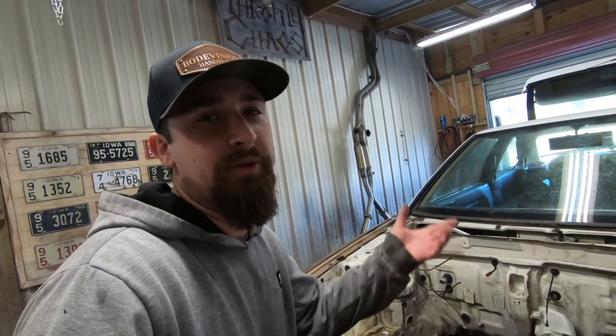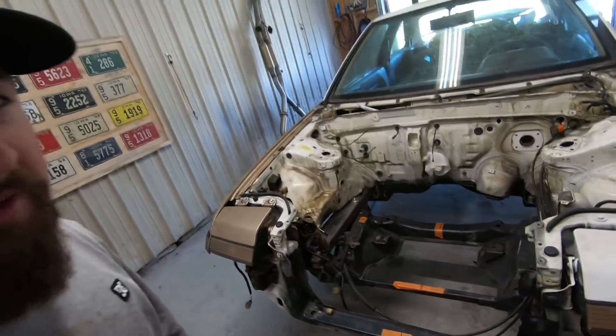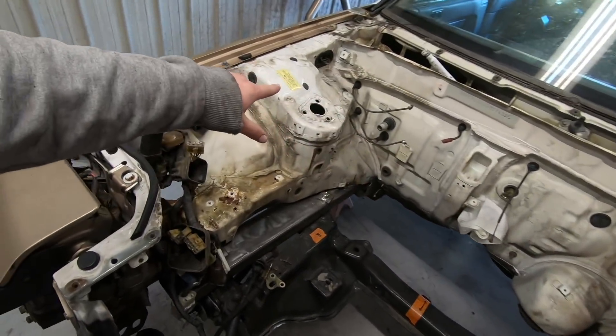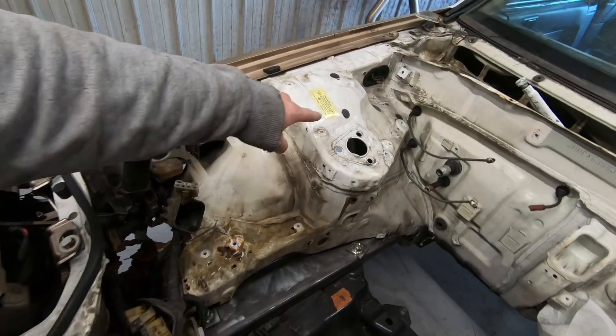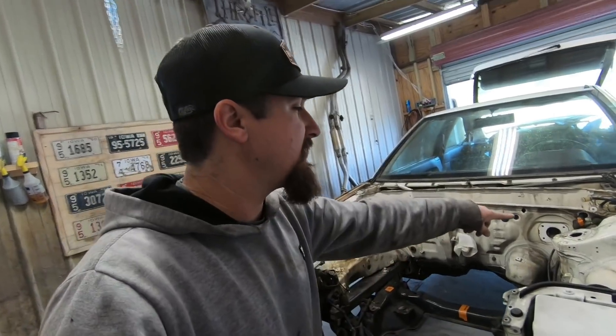In this video we're picking up exactly where we left off. The first thing I want to do is check my work. We've got the subframe welded in here — it's a little more than tacked. I can move backwards or forward if I need to, so it's not a for-sure thing yet. This entire section is going to be redone. The tops of the shock are going to go way further out because I want to keep the suspension geometry the same as how they engineered it. First I've got to get those old things cut out so the shock can come through there.